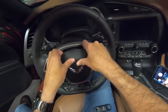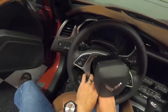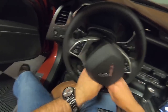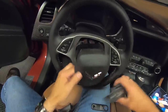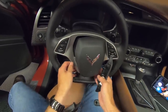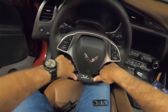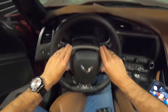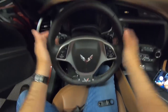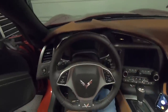We only have to pull the airbag out just a little bit — just get it like so. Then once we get this out, we can grab the silver trim part here and pull it out just a little bit. That should allow enough leverage to be able to get the new plate underneath. I can go right here like so and it'll fit right into the slots, just like that — fits in nice and pretty. Then I can press the silver part back in place, push the airbag in, and we're done. It fits in there nice, we didn't break anything.